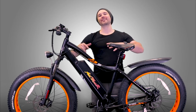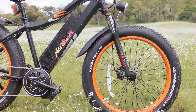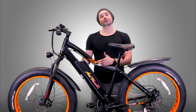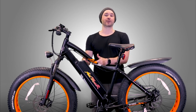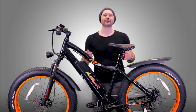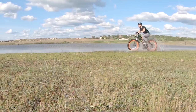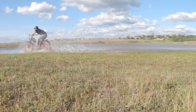Moving on to the middle of the bike, we've got this massive 48-volt, 17.5 amp-hour battery. It's got Samsung cells in it — a really high-capacity battery. Most high-capacity batteries on electric bikes are around 13.5 amp-hours, so this thing has quite a bit more juice. It is removable with the turn of a key so you can charge it on or off the bike. It also has a USB port on the right-hand side to charge accessories on the go, and you can use it as a portable battery bank. Even with this larger battery, I still think the range will be around 30 miles, because the extra-wide tires create a lot of rolling drag that will eat through the battery.